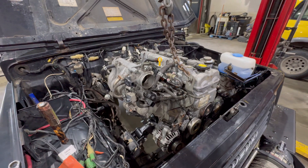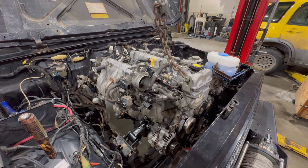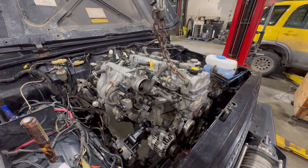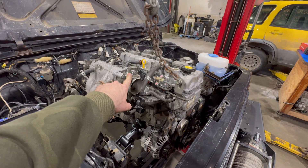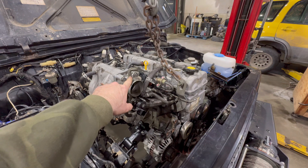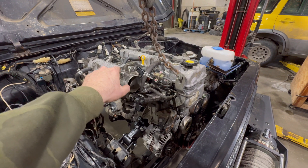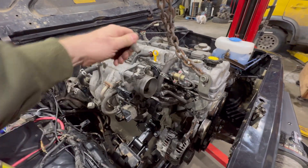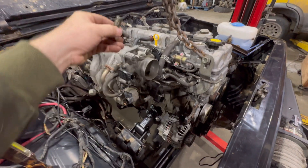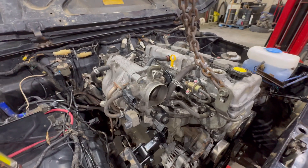I just dropped part two of this series and Kenneth SS8ML commented and said he did the swap before, and he said on this 90 degree elbow coming out of the throttle body to cut it down, RTV it, and put it back in there. So I just pulled it out with a pair of vise grips and we're about to cut that sucker off and lower it.